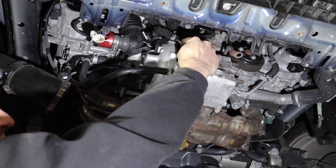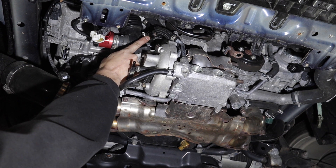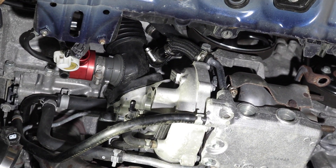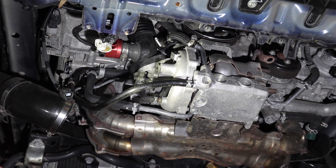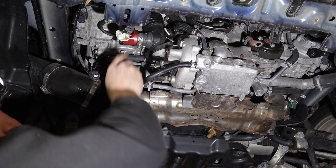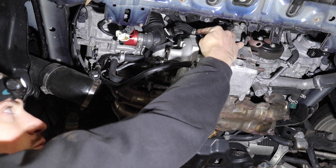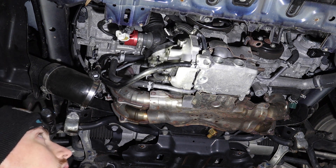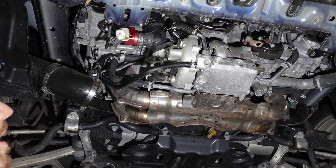This is a vent - when you pop this off it doesn't flow anything, but it is oil. This is where you install the oil sump restrictor, which I already have installed here. This is a highly recommended and easy mod to do when going with an aftermarket J-pipe, especially catless, to keep that blue smoke down from the exhaust. I'm going to take this worm gear clamp off to separate that hose. If you're doing this mod, cut the hose to install it - don't mess with the factory clamps because they're kind of one-time clamps.